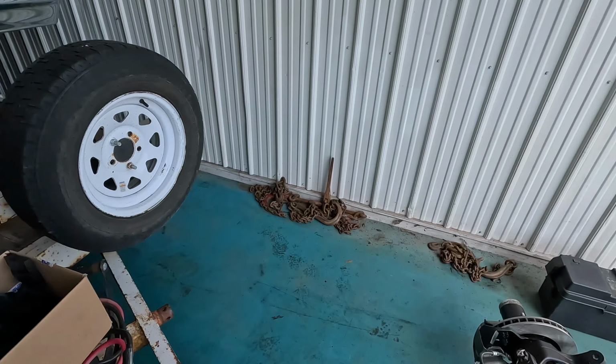This is that spring bucket that has the hole in it, obviously. So that's no good anymore. Probably could be fixed, but I'm not going to. Frame looks pretty good. I mean, there's still some factory paint under there. So we're getting pretty lucky for how rusty some parts on this truck are. I decided to just take the shock mounts off and everything, and then we'll get the frame wire wheeled and put some paint on there. So at least there's some paint behind the shock mount and the spring bucket, so it doesn't start to rust behind there.